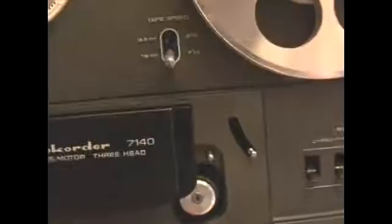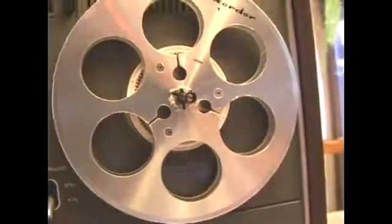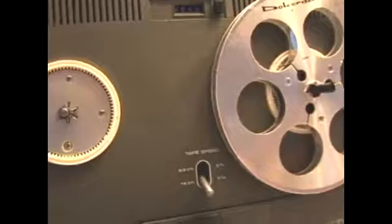The other reel that will turn is down here, but that's turned from the back — that's the capstan motor. This is the take-up roller here, and you have to take this other piece off, like we talked about before, to actually lubricate that. I've never actually done that. So those are the three motors that you actually lubricate here.